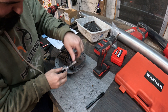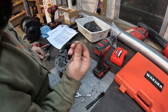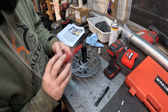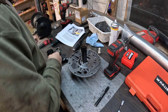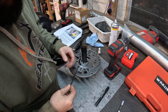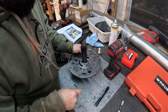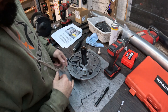This is the second time I've installed this kit — I'm reusing it, had to pull the other transmission apart. Now I'm going to clean it up. The instructions say to use a dab of red Loctite on this brass set screw — just a dab around the threads; you don't want it poured on there and flaking off inside your transmission. Run it in there below flush, bottom it out to the threads you made.